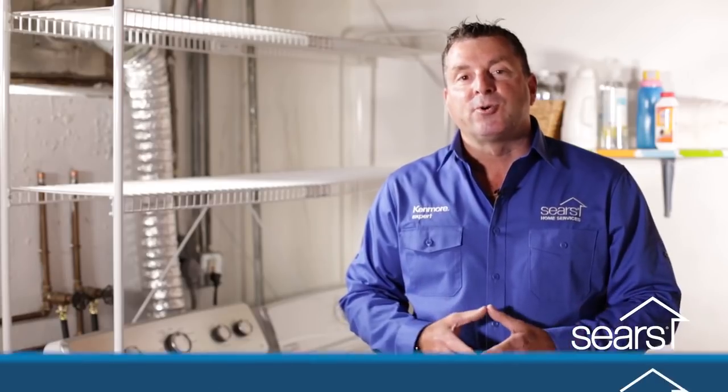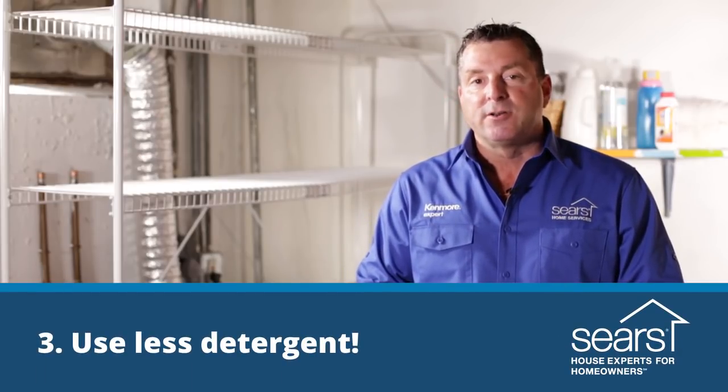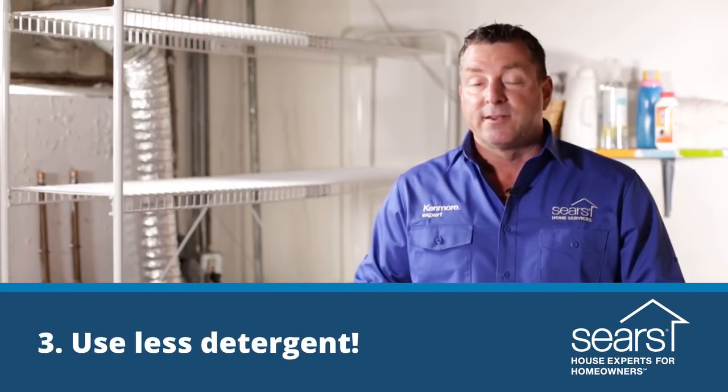We've learned in the industry that the actual amount of laundry detergent needed to clean your clothes does not necessarily reflect what the manufacturers call for. In a high efficiency washer, we recommend no more than 1/4 of a cap of high efficiency detergent for a large load and less for smaller loads. In a standard operating machine, we recommend no more than 1/2 a cap, and of course less for smaller loads.